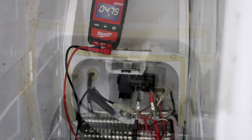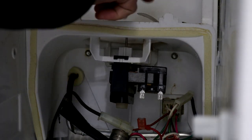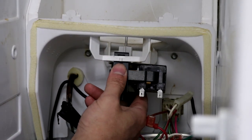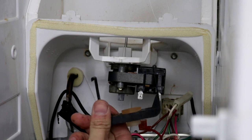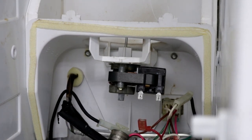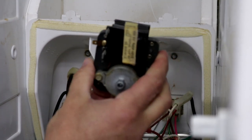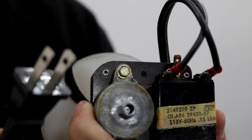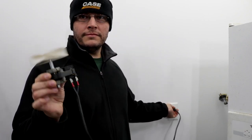What I'm going to do now is show you how to remove the fan. The first thing you want to do is get the fan blade off — just get that popped out of the way, try not to break it. Next, undo the clip that holds the motor to the assembly. Once you've got that out of the way, the only thing holding the fan in place is a little rubber grommet — just wiggle that out and there it is. Pretty easy to remove. You can see I've got a couple wires attached to it with a little plug.